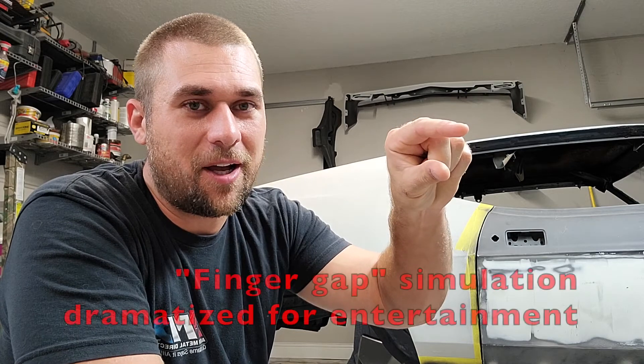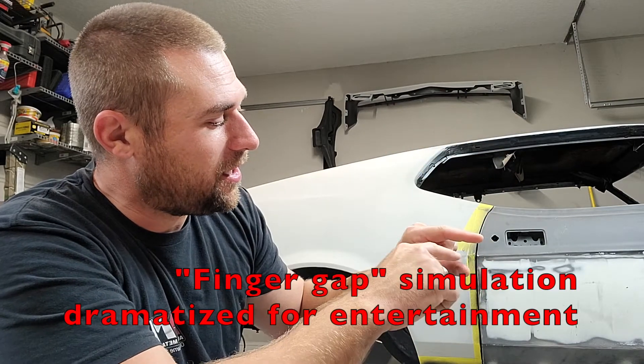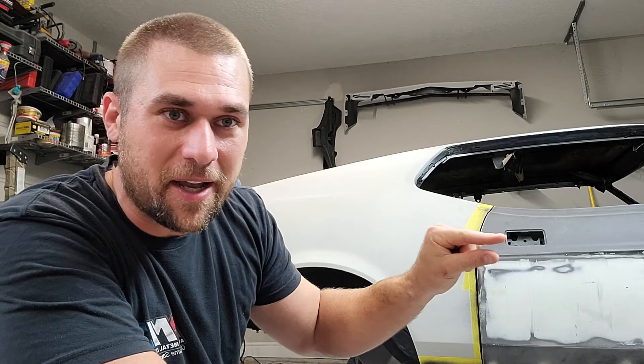Now when you can't adjust anymore - like I've seen on C10 trucks, the gaps are crazy, it's like every day they were printing a new stamping for those doors. You have to take rod and run it down the edges of the doors to get the edge longer and close that gap up for a uniform fit. I had some of that in a video I made but it got destroyed because the SD card broke in the GoPro as I was pulling it out.